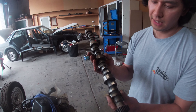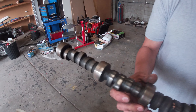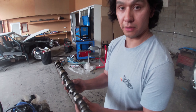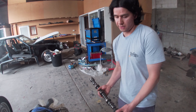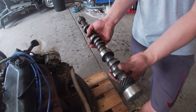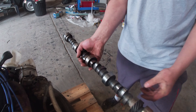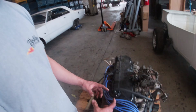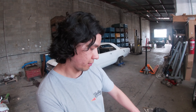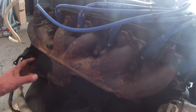Let's talk about upgrading everything else. I've got a big stick here with a few lumpy bits and bobs hanging off it — this is the camshaft, what they call the brains of the engine. Each of these lobes are machined precisely in the right location to basically tell the inlet and outlet valves what to do. One of the biggest things you can do is change the cam, and what you can do with this motor is get it to be more aggressive with the inlet and outlet according to your fuel ratio and other calculations, to make sure your engine makes more power. Basically, you've upgraded your fuel system, bored out your pistons, tightened up the tolerances, got some new pistons — everything's been redone with the camshaft.